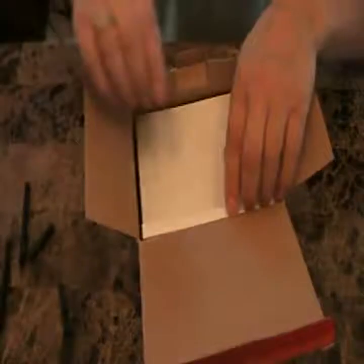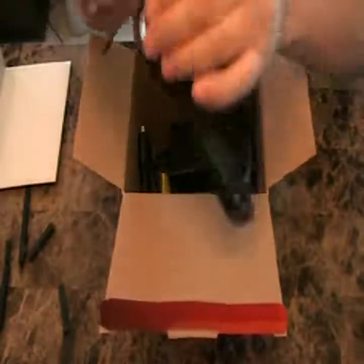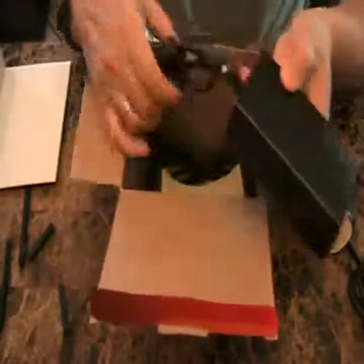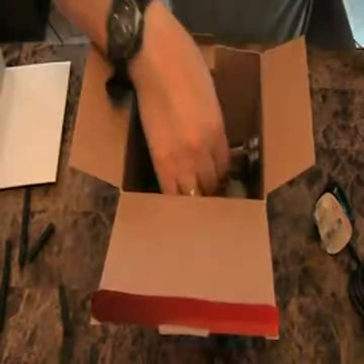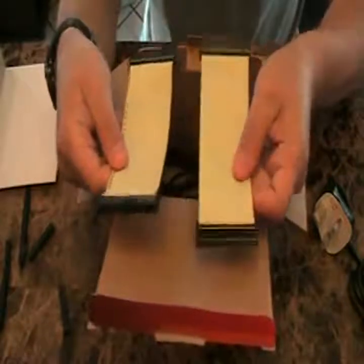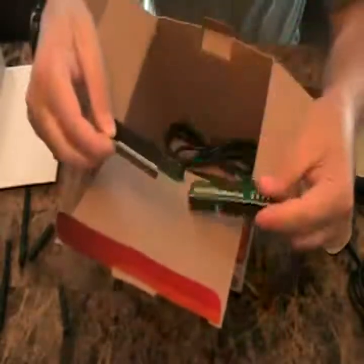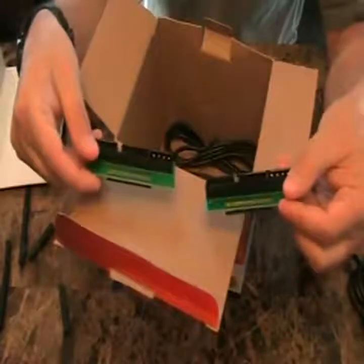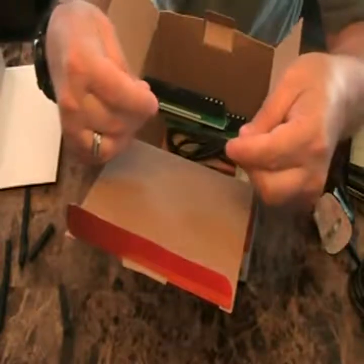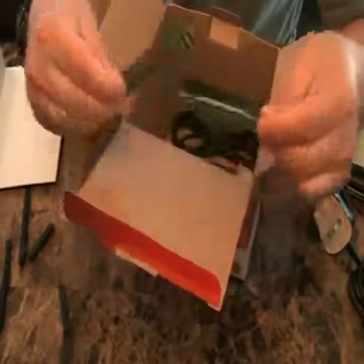In the box you've got your standard power cable, one for Europe, and the power brick that plugs into the unit. You've got two short IDE cables. There are two adapters for converting a laptop IDE drive to standard IDE, so you can clone an IDE laptop drive. Laptop SATA hard drives use the same connectors as desktop drives, so you don't need any adapters — this is just for laptop IDE drives, and you've got two of them.